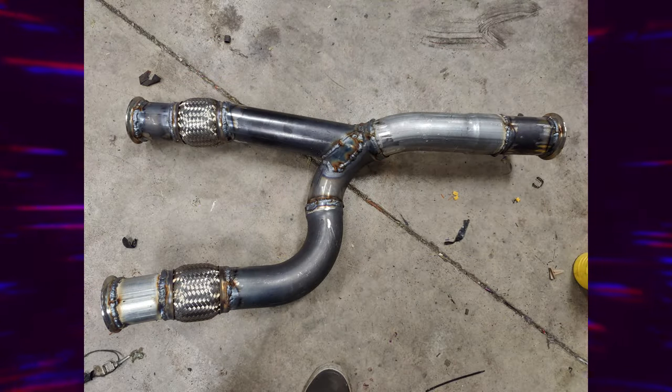The RX-8 was more complicated. Most aftermarket RX-8 catbacks are only two and a half inch, and each header coming off the LS had a three-inch outlet. I didn't want to constrain flow and I already had a bunch of three-inch tubing left over from the Subaru swap, so I decided to fab everything using three-inch tubing and spare parts. This was a bit more time consuming; however, the same rules applied — I'd mock things up under the car, tack them in place, and then send them home with the welder. The only real issue is the Y-pipe that combines the two headers together hangs pretty low and has to go around the transmission, so every now and then it'll grind on the ground.